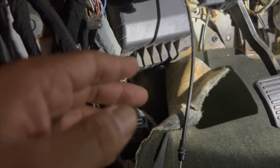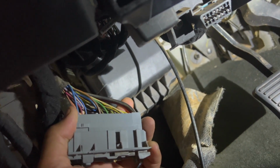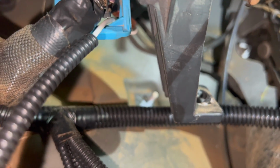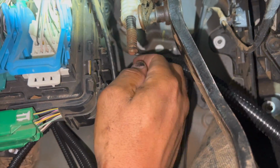So here we are on the driver's side. Same thing as the passenger side. Got our door harness off, and we're about to load up the blue wire into number 11 and the white wire into number 9. Junction box here. We have spliced into the black connector as directed and put the T-tap on it. Right there, it's kind of hard to see, but got our T-tap on there, hooked it back up, and ran this wire around the bolts for the main harness.